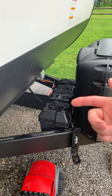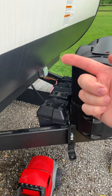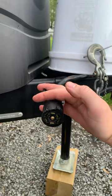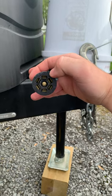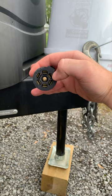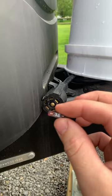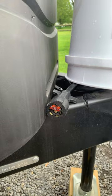Your camper is already outfitted with one or two 12-volt batteries that run all the stuff inside of the trailer. If you take a look at the plug that goes into your truck, these top two pins are the ones we're concerned with — this one is 12-volt power and this one is for your marker lights. So in order to turn those on, you simply take a fuse and jam it into the plug. And voila, your marker system is hot. This is a super useful hack because you can turn on all your exterior lights without being hooked to your truck.